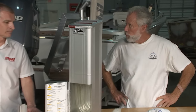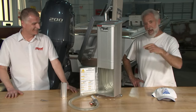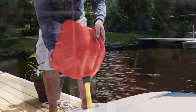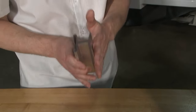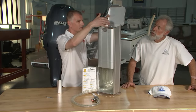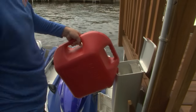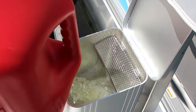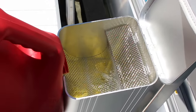A full five-gallon can weighs 40 pounds. How long are you holding it before it's empty? With the Lily Pad funnel, I hold it for about 50 seconds. Maybe somebody at home should time themselves on how long it takes to put five gallons in their boat. With our modular mount bracket, you mount this solid to your dock — the funnel slips into it and you can just set your can up here and pour it in, so you're no longer having to hold 40 pounds. The screen prevents the glugging, because there's no vent in these cans, which causes splashing fuel. It captures it and sheets it to the bottom so it keeps it from splashing out into the water.